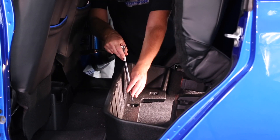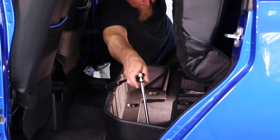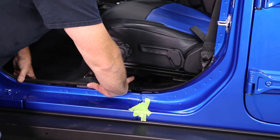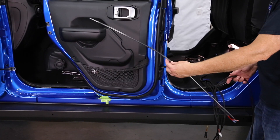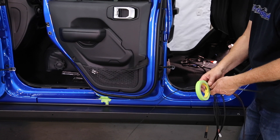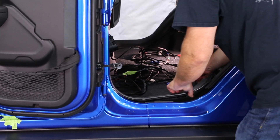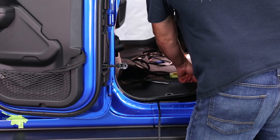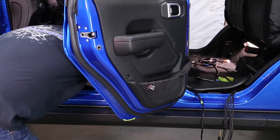First step inside is to remove the rear tray using a 10 millimeter socket — pull the four bolts and the tray comes out. Pull the trim up on the driver's side, both front and rear. A useful wiring trick: source a really long zip tie, cut the end off, and tape wires to it. Fish the harness right down past the bolting boss, going underneath the carpet, then fish the main lead along the rocker panel up toward the front.